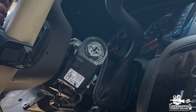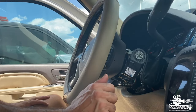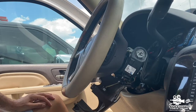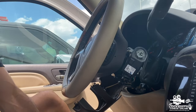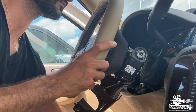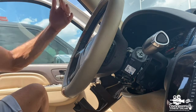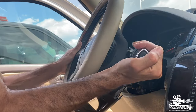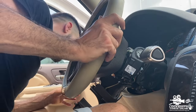The ignition is now in the ON position. You can see the dashboard lights just came on. Make sure you press the emergency brake all the way with your left leg. Then press the brake pedal and move the stick shift from Park to Neutral while keeping your foot on the brakes — we don't want the car to slide. We can do this now because we've already picked the ignition.